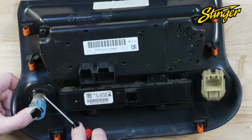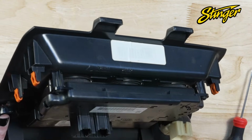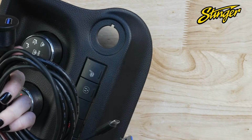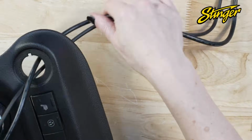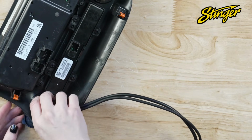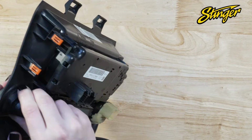Remove the metal insert from the power outlet by releasing 2 retaining clips with a small pick tool and pushing it out the front side. Then remove the plastic sleeve by depressing 2 tabs and pushing that out of the front. Install the optional USB cover and feed the USB cables through the front of the panel. Secure with the flange nut and then lock with the lock nut.